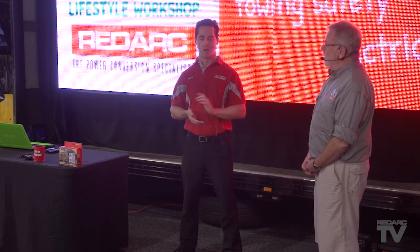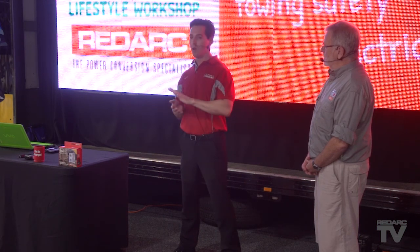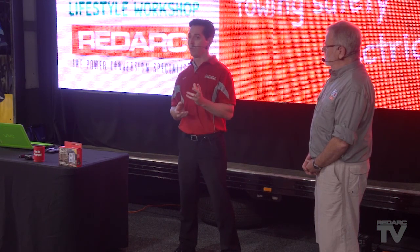The amorphous panel we have here is a 24-volt capable solar panel, and we need to take that high voltage and put it into our 12-volt battery safely — that's what the regulator does. To charge the battery, we need to put the voltage up higher, but then once the battery's charged, you need the regulator to also back off and safely keep that battery trickle charged. That's what the battery charger solar regulators do.